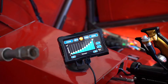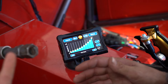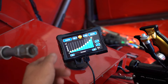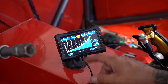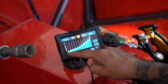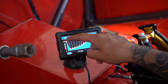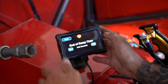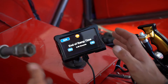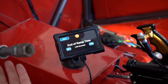For those of you that don't know what a progressive nitrous controller does, it basically gives you the power to control your nitrous — how it comes in, how hard it hits, whether you want all of it right away or you want to kind of stretch it out. I have mine set up on a time-based ramp. You can kind of see the curve here of the dots. It starts on a percentage — zero to 100%. You're also able to control the time of the ramp. Slow it down, usually for crappier surfaces. Speed the ramp up, usually when you're on a better prepped surface.